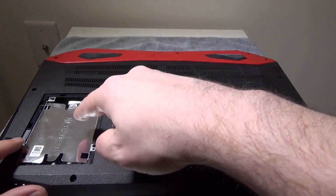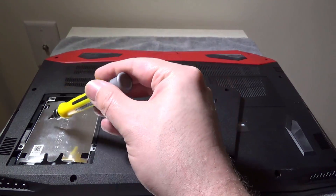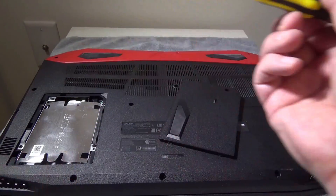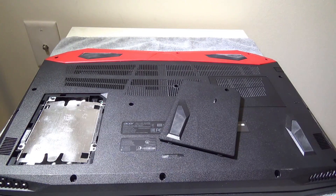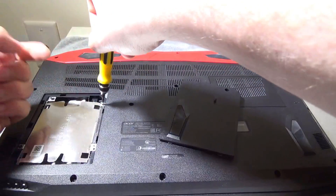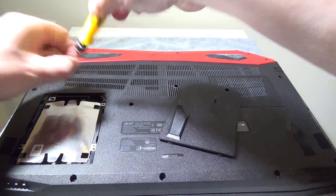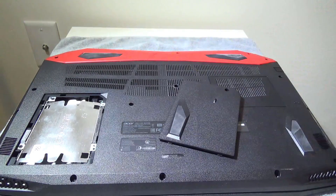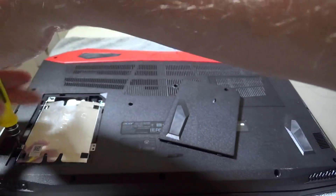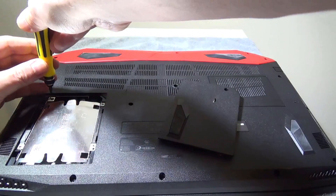Now you actually have access to your secondary hard drive bay. They do include the mounting hardware, unlike when they launched the VX15 where you had to actually request it — they are including the caddy and everything. They also have four screws that not only hold this in, but they give you four screws to actually add a hard drive as well, and that comes in the accessories box that has your power supply in it. Let me get these screws out quickly and then I'll show you how to add a hard drive.